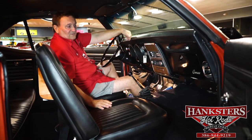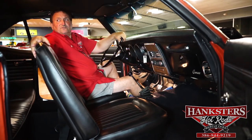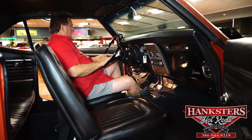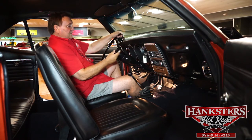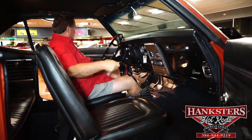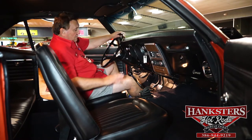The interior is very spartan: basic seats, carpeting, no console, grab rail on the dashboard, original sun visors. The hat rack is just as new. Back seats match the front. Door panels are absolutely flawless, just like the rest of this vehicle. There are no cracks in the steering wheel, no imperfections in it. The dash is crystal clear — it has a speedometer, some idiot lights, and a gas gauge. If you wanted a tachometer, you put your own Sun tach or Stewart Warner tach on the column, and that's what guys did with these cars. The hardware on the door panels — your openers and window cranks — are just as shiny as can be. No imperfections on the armrests on either door. Bright trim around the gas, brake, and clutch pedal. Parking brake cable is still nice and clean and clear.